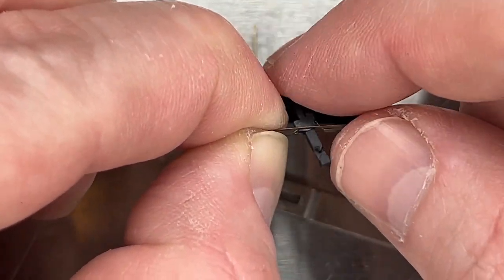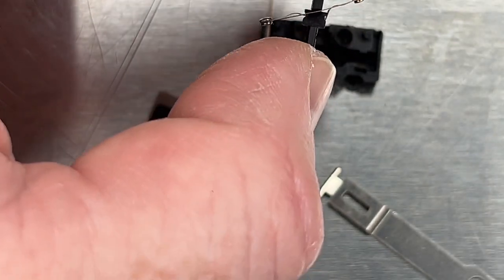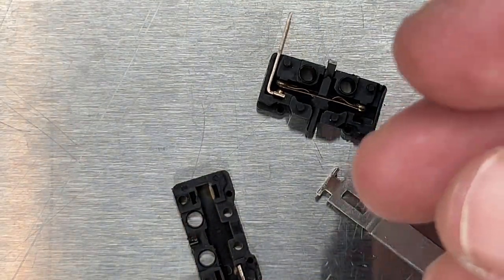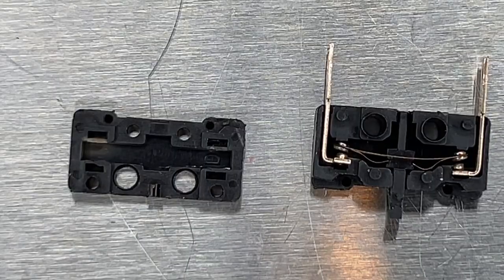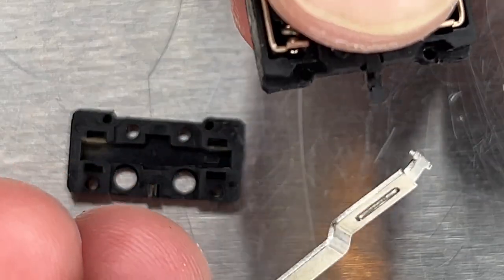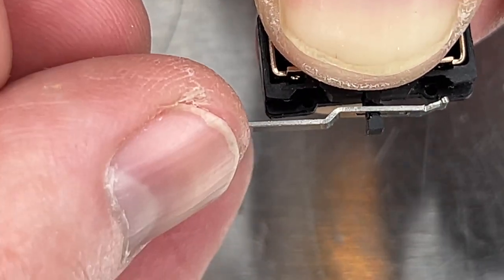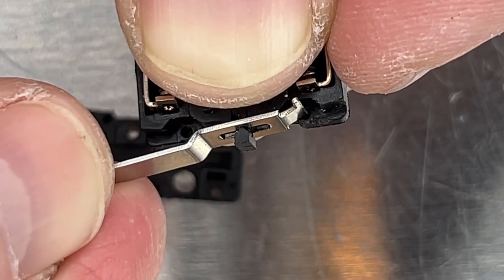There's a link below for a $30 replacement switch if you just can't get it working again. Now we're going to sit it back into the housing. Before you reconnect the two halves of the plastic housing together, this metal tab needs to be put back into place. To do that, take the portion with the connector pins and get the rod inserted by placing it over top perpendicularly, then a quarter-turn rotation gets it put back into place. The two pins at the end get inserted into the holes in the plastic housing.